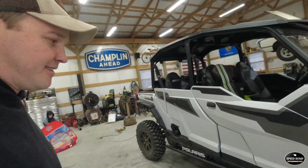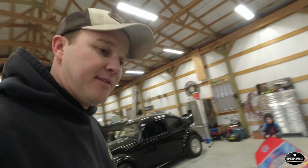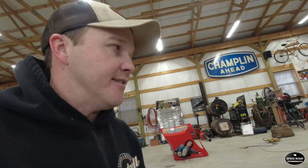I got the first side on and it went fairly smooth. I ran into an issue on the back bolt. It sent special nuts for those back bolts with holders on them, because there's not enough room to get a wrench in there. They look like this. Well, this bolt hole was all the way up against the cross member, and I drilled it perfectly straight, as you'll see in a minute. I don't know if the cross member is in a different spot on my rig, but the nut wouldn't fit. So I notched the hole a little bit and it still wouldn't fit. So I ended up grinding down the nut and the holder, and I'll show you a picture of that here.